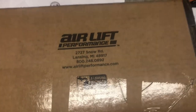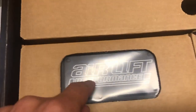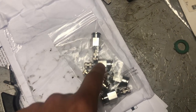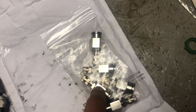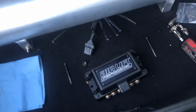It's about two days later and look what we got — boom, came in the mail! I also grabbed these quick-connect fittings because I didn't know about them before. Basically you put them on the ends of the line and you can add air to the bags manually, like how you add air to a tire, so the car will air up even without the manifold connected — you just won't be able to control it electronically. Brand new — that's how I like it!